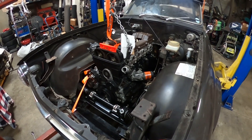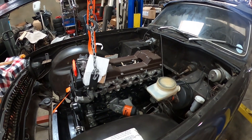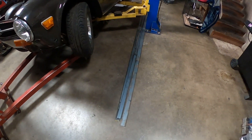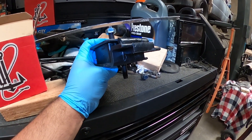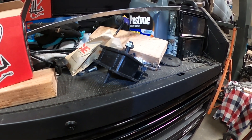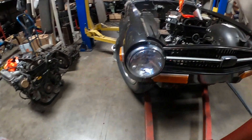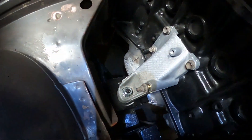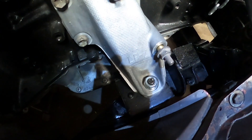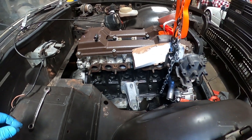As long as I can get it running and working I'll be happy. I'm going to start working on the motor mounts — I bought material to do the brackets. These motor mounts are from a '97 Dodge Viper, about $20 each, and they should be strong enough. I've used the ones from Dodge vans and pickup trucks from the 90s and they work well — in this case I'm going with the Viper ones. I already installed one of the mounts. I'm going to keep the original 2J bracket, then fabricate another bracket that bolts onto the chassis, weld them on, and bolt everything down.